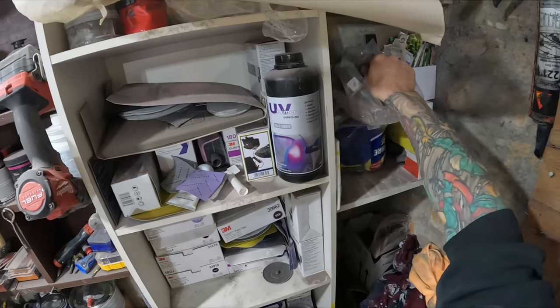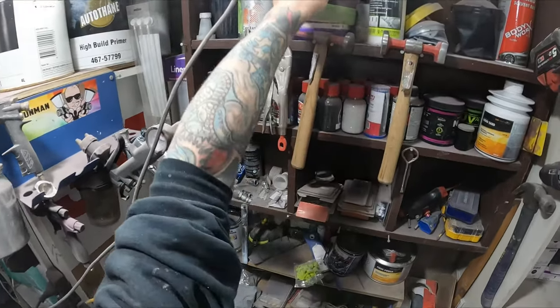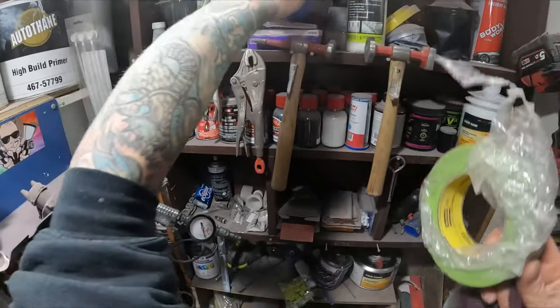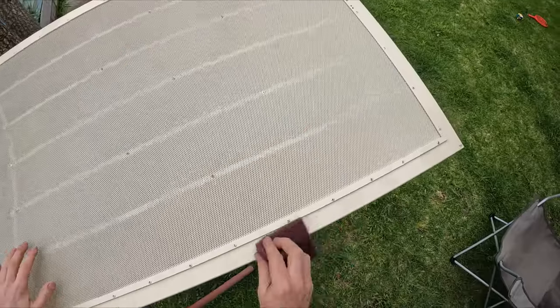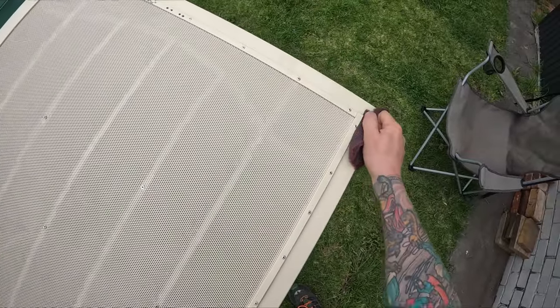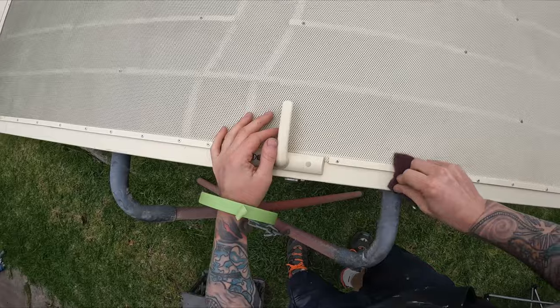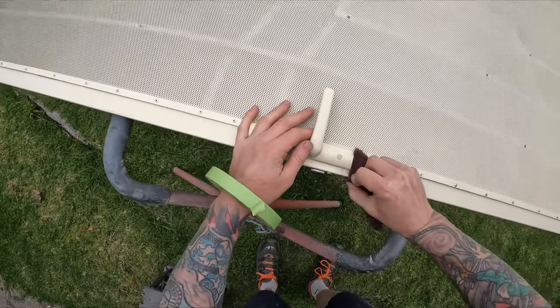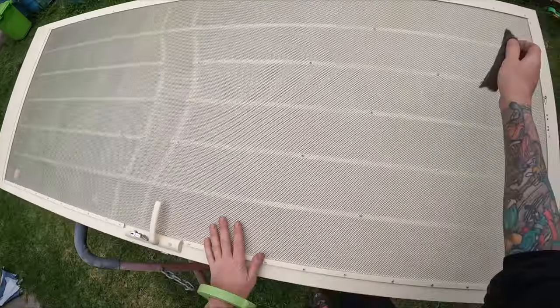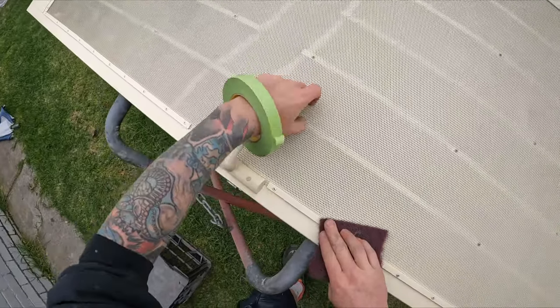Anyway, let's just get stuck straight into the prep work — it's a pretty straightforward job. I'll do a little bit of a video on it just for something different. So we've got ourselves a microfiber cloth to wipe it down with. This job does not have to be perfect, so we've got a scouring pad and we're going to need to do a light bit of masking just around the lock mechanism — mainly just around this frame part here. You want to get the gloss off, knock that gloss down a bit so the paint is going to stick to it properly.